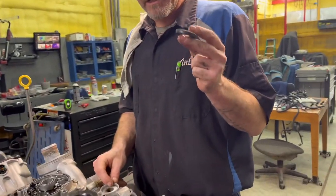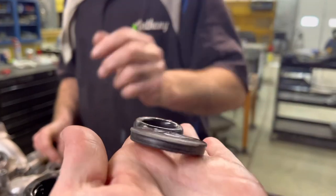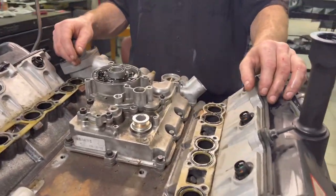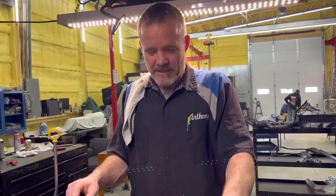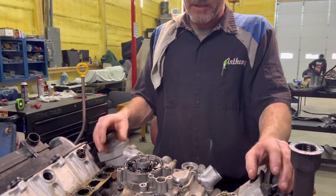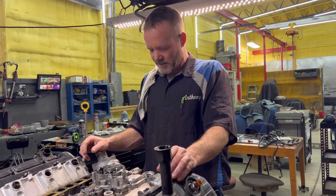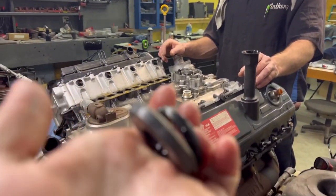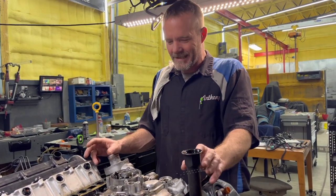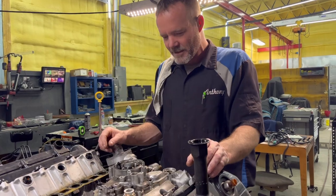You know, that right there is probably an indication that I'm tightening the intake too much. How much squeeze do you guys put on the intake? I tighten it down until it's tight. It's probably about 15, 17 foot-pounds. They call for 10, so you can go down and just lightly press it. So I probably have been guilty of tightening intakes too tight. That's a fine line, because you could wind up tightening it too loose. Then you're leaking coolant. Air ain't so bad. You can leak a little air and it'll still run, but you ain't gonna leak no coolant. You leak coolant here in the front cover, you're wondering why.